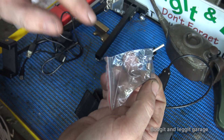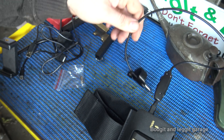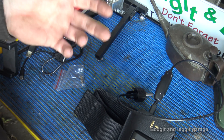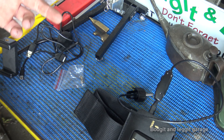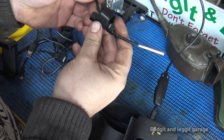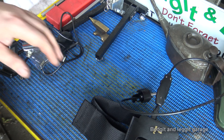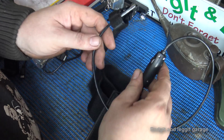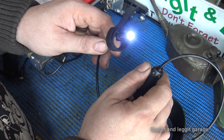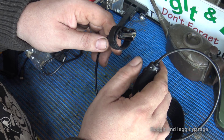And this is your actual finger scope. They give you a little mirror which, when plugged into the scope, flicks it back up 90 degrees — so you can put this down a cylinder and look back up at the top of the piston, the valves, or anything like that. You don't have to use it on the end of your finger, but you'll see why that's really good in a few minutes. There's a control right here for the light, so you can turn it fully on or off depending on how dark the space you're looking into.